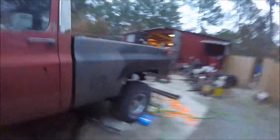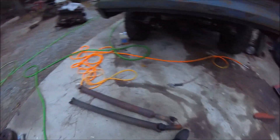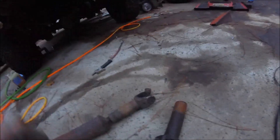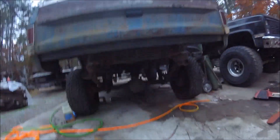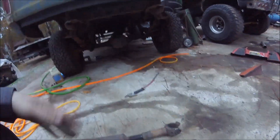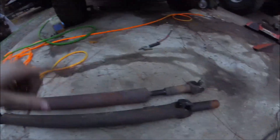What I'm up to now is I have my drive shafts. You guys remember this truck had a 700R4 in it which had the slide-in input. That's the old drive shaft. Now I have the 205 New Process and it has yokes on both ends with universal joints. The problem is this truck shaft is not going to be long enough. Being the truck is lifted and everything it just does not have the length it needs - when I put it in there to hook it up, it's fully extended, and if you got any articulation in the rear end it would just try to pull out. So we can't have that - it needs to be lengthened.